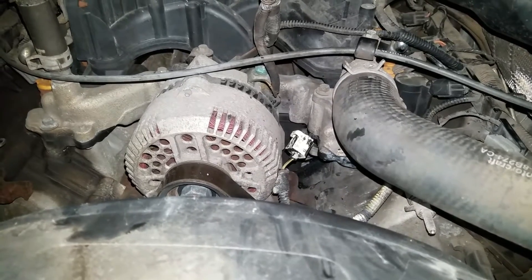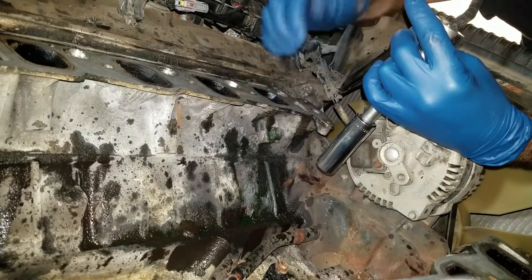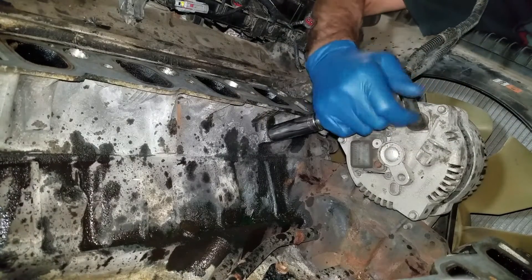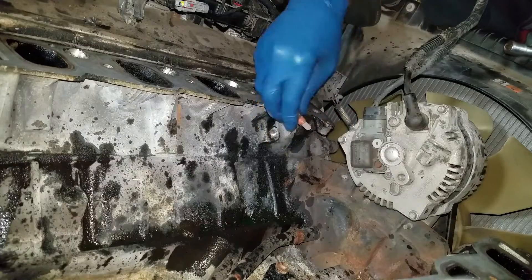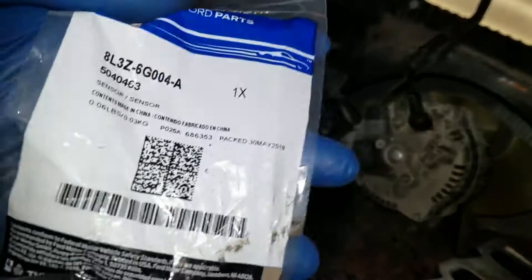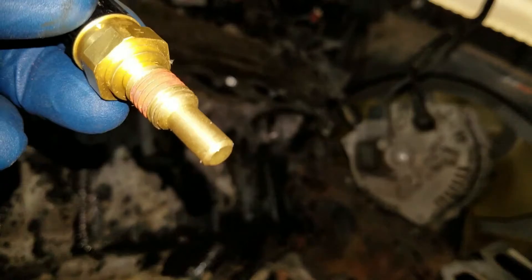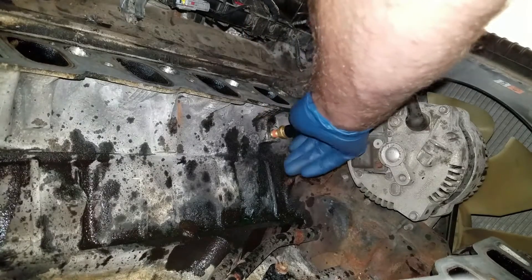It might have gone bad just because it's been dripping coolant on it for years. This sensor is a 19 millimeter — I yanked the wires right out of the thing; it's not very tight. I'm actually using a 3/4 inch socket — same size. I cleaned the surface a little bit to make sure there are no big chunks of crud. I went to two different parts stores and they gave me the runaround and tried to sell me the wrong sensor — they all tried to sell me the one for the gauge — so I had to go to the dealer. That's the factory part number; the sealing surface is brass. I'm just gonna throw it in there — it should seal just fine.